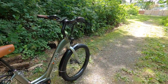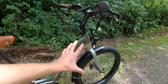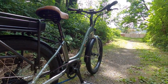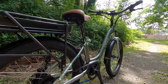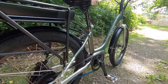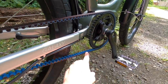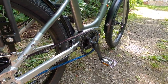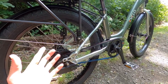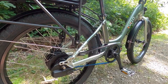And even the bike — it says Evelo but it's not like a crazy color scheme or anything. I really like the dark gray and then light gray — they're metallic, so it's almost like a silver frame with a little bit of accents. They've got bottle cage bosses, fender bosses, headlight mount, and rack bosses. And then look at this — there's a split right here in the frame. The reason they had to do that is because this has a belt drive — the Gates Carbon Belt Drive CDX, which has a center track that keeps the belt from shifting side to side or falling off. There isn't an actual break in the belt, so they had to do a break in the frame instead, and that does add to the price of a bike like this.